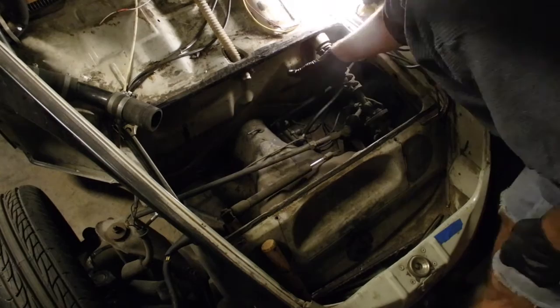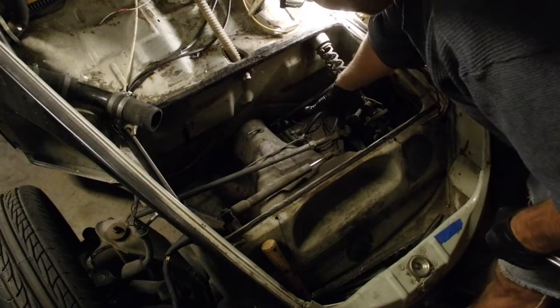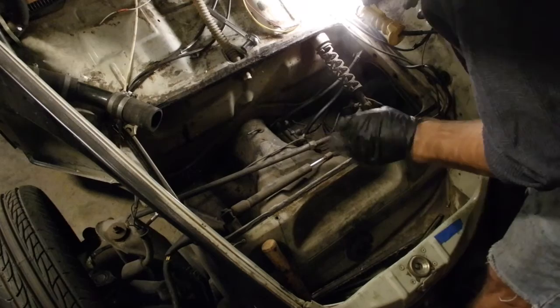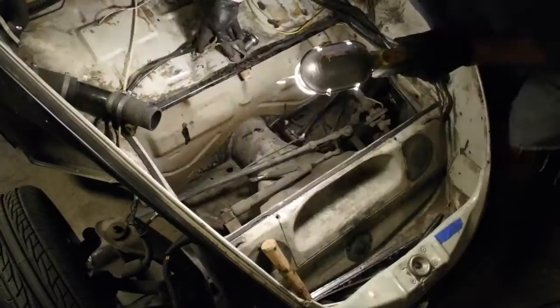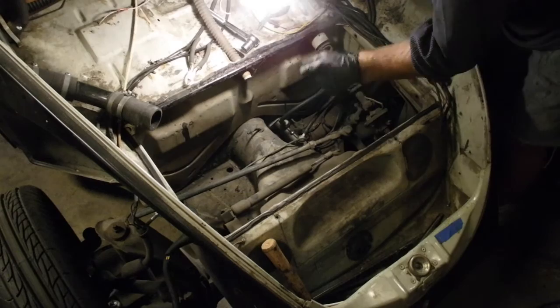The trick I'm going to go with is replacing one link at a time without moving the other one. The thing is on its wheels, so hopefully the steering won't change. I can replicate the exact distance and put each piece back in. I do not want to have to take this thing in for steering alignment, so if I don't change anything I know it's good to go. When taking out an old cotter pin, I cut the loop, then pull back and pull one half out at a time. Not a revolutionary idea but it works well.